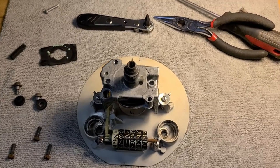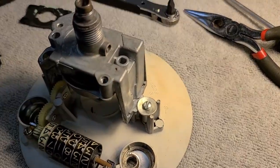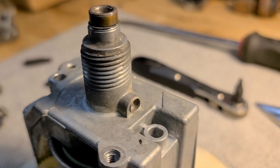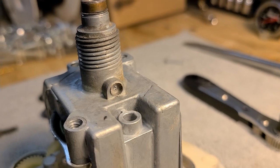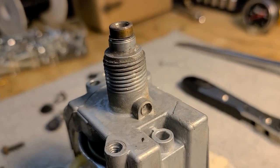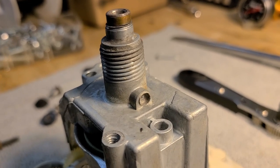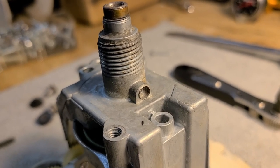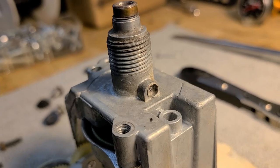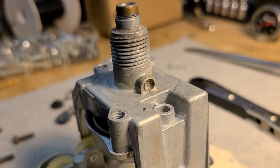Solution found. After removing the gasket I noticed a small nub that was there for a reason - looking closer there's a tiny little plug in the end, almost like a freeze plug you'd see in an engine. That is the lubrication port. Getting it out is tricky without the right tweezers or pliers, so going to use a more forceful but delicate enough method to avoid damaging the speedo.